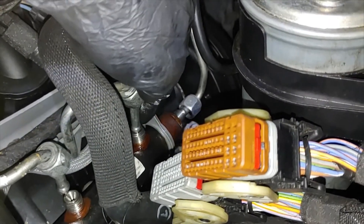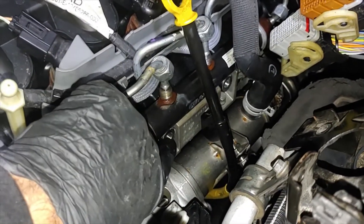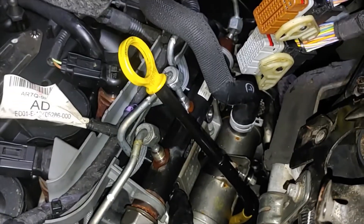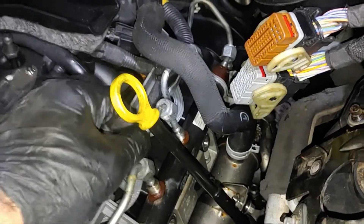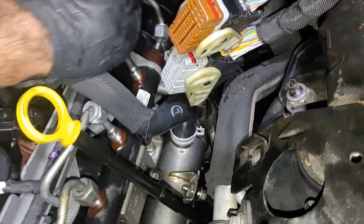If they are not properly seated, you're looking at a fuel leakage. Now it's properly seated — I made sure all of them went in, but these were still popping out a bit. So I used a chisel and hammer, placed the chisel on the nut positions and gave a few gentle taps. After a few taps, it will go in nicely. Once they are in, put the nuts on, and wiggle all the fuel lines a bit so they have enough room to seat properly on their own.